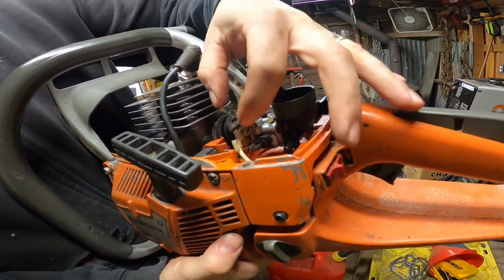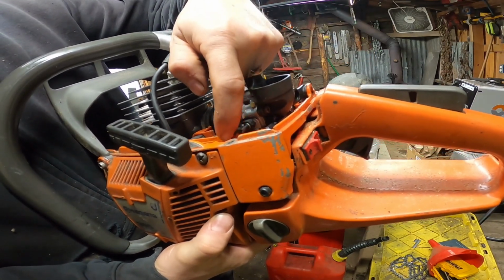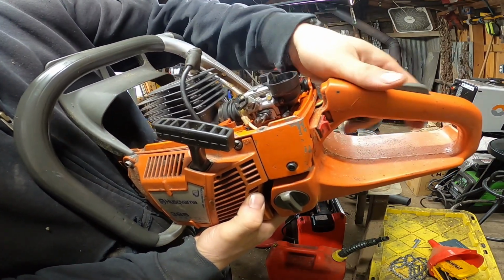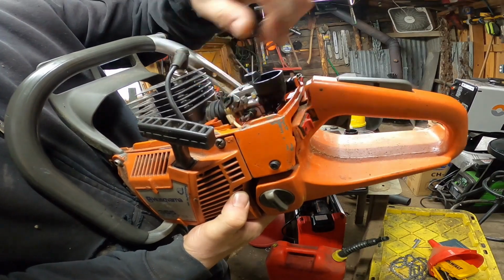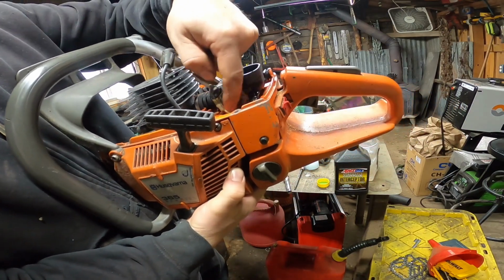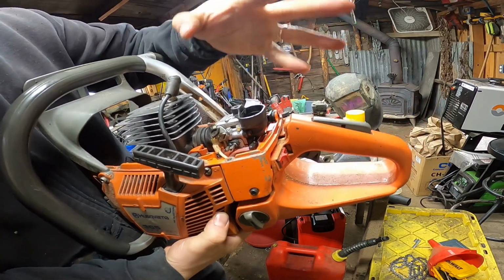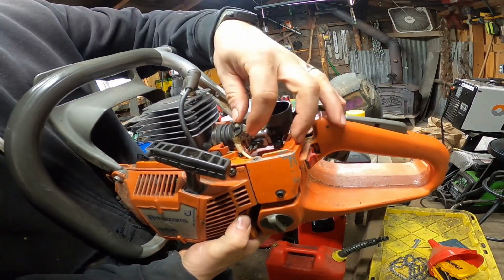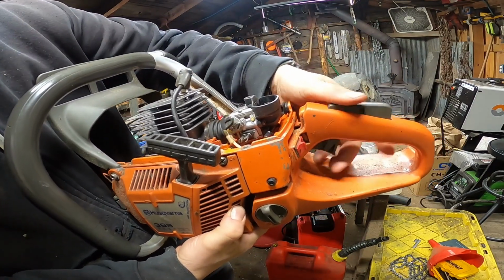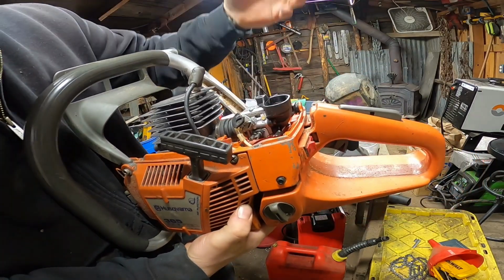This is just a little holder. It keeps the tension on. It's basically a straw. There's a cable inside of a straw. That straw goes into that holder. That way the cable can move, basically. See? Now, if it wasn't in that straw or that cover, the cable would basically just kind of be limp on itself. So then we just pull the throttle back, flop it in there. Boom. This is our idle, low, high, vice versa.